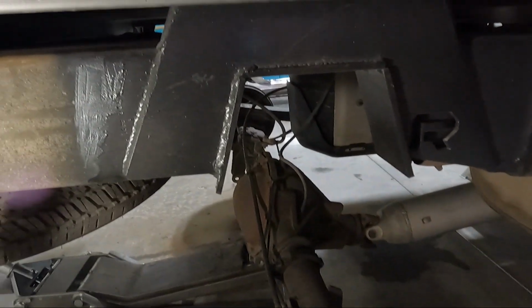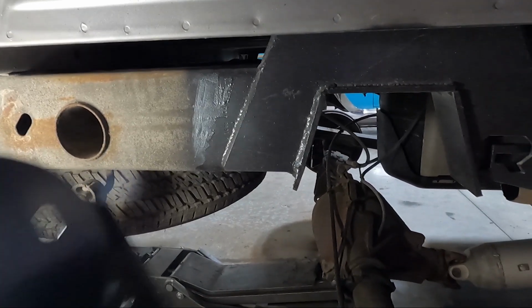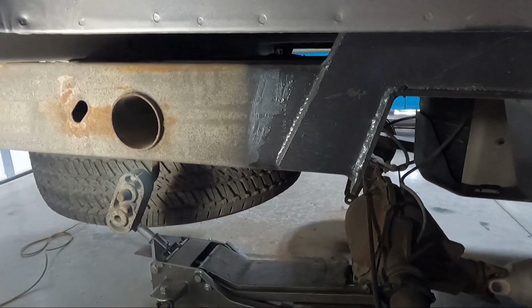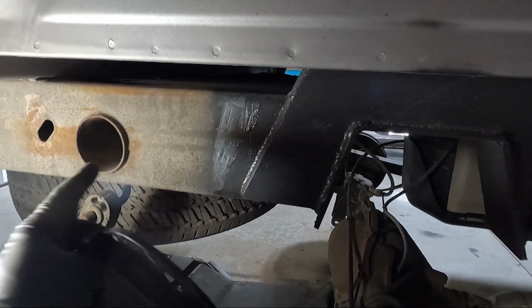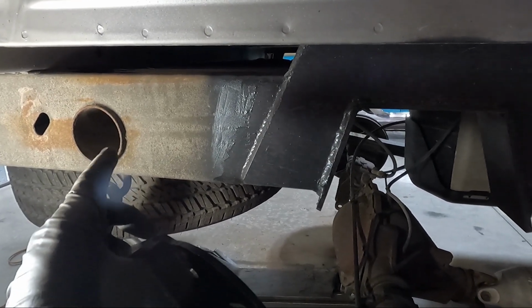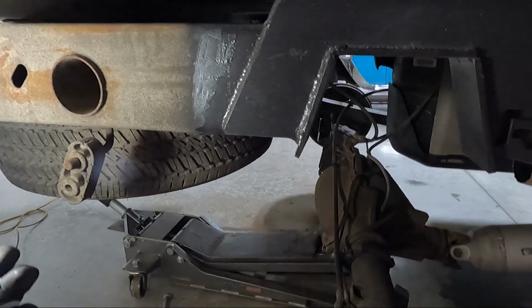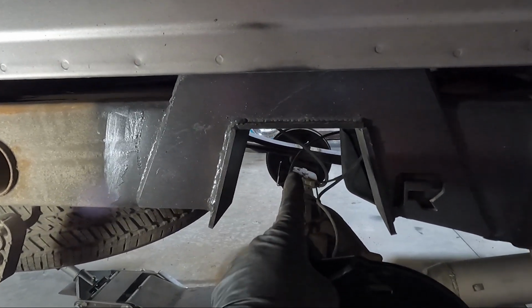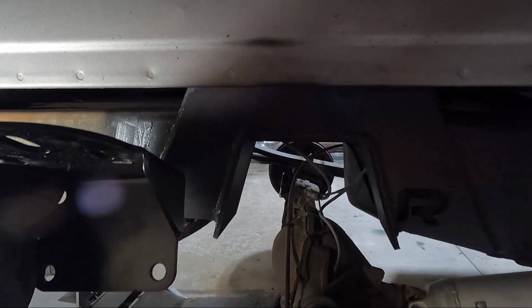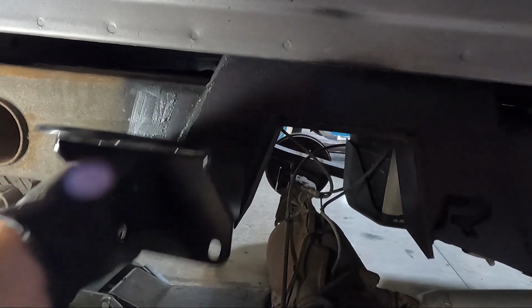The other thing is I do have my green truck. If I wanted to, I could go over there and measure, because I do have the bolt-in C-notch from McGaughy's on it, and I have the exact same helper bag kit. But I think we're going to go with what we've got here, because I'm not going to get an accurate measurement, seeing as it is a 6 foot bed compared to this 5.8 or 5.9 foot bed. So my measurements wouldn't be the same. I would have to literally measure from maybe the center of the opening to the front or the back of this, and I might do that. But either way, I think, like I said, I'm just going to set it up in here, mark it and drill it, and we'll get it bolted in. As I said, I've got it up there.